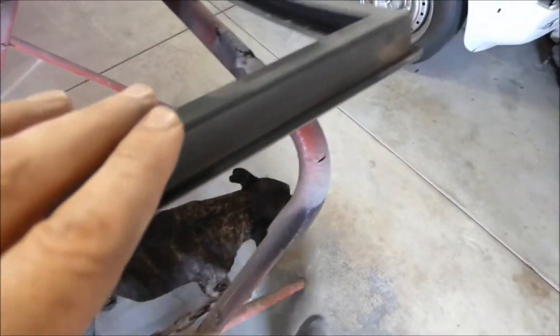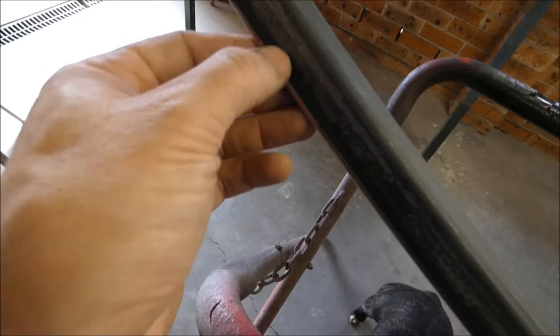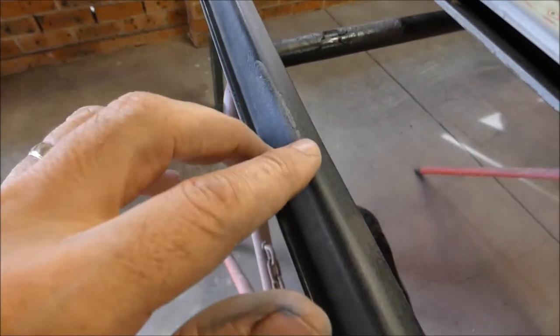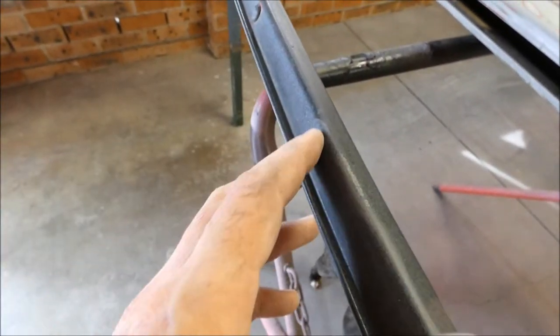So areas like that, because if you only just sand over it, you haven't sanded the lower section of it, where the actual chip is, and you haven't roughed it up, so nothing's going to attach to it. Plus it looks much cleaner when you feather edge things out, because the paint will just lay on nice and smooth. You won't notice things too much, whereas if you just paint over a chip, even though it's all the same color, you'll still see the divot where the chip was and where the paint's gone into the divot and then laid itself on top of the other areas.